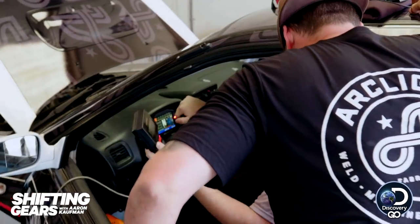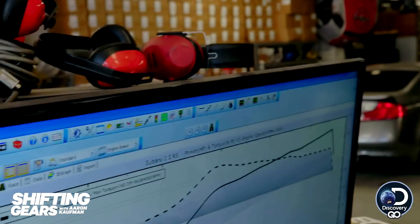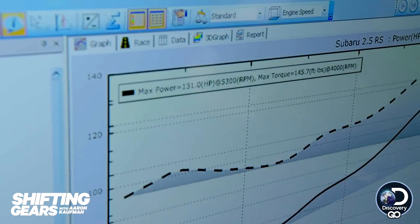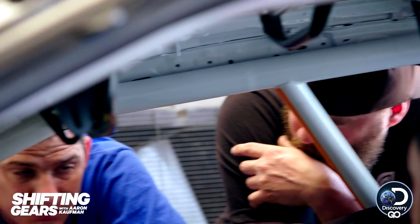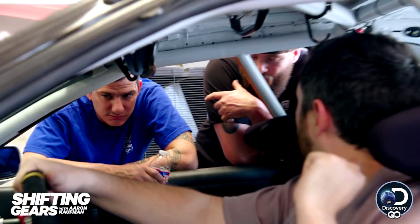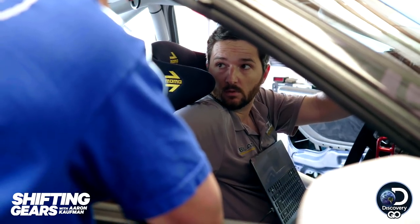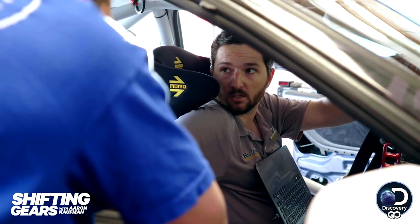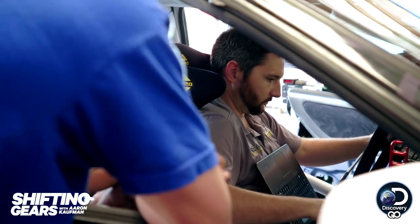It's almost 150 foot-pounds — but there's a mean vibration. It could be the tires, but it felt more like driveshaft vibration. I stayed in it through the end of the pull just to get data, but it felt real sketchy — the trunk was shaking like crazy. So we'll do a couple of pulls in second gear to dial in fuel and call that done, so we're not dealing with all the crazy RPM.